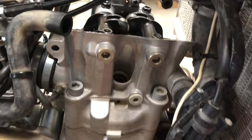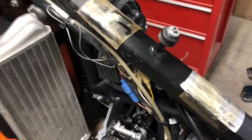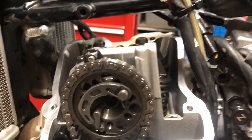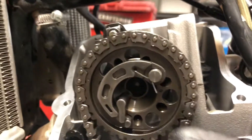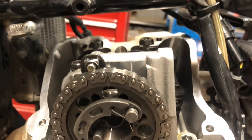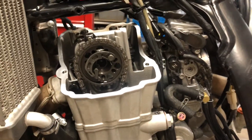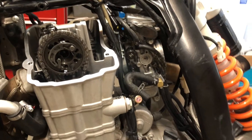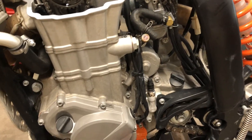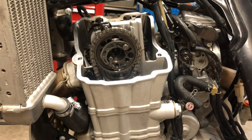Here's the motor with the valve cover taken off. I've also removed the spark plug, and that's going to do two things for us. First, it removes compression from the engine so that we can rotate it to find top dead center. It also provides a second way of verifying that you're at top dead center. What we need to do is align this little dot on the cam with this little impression drilled into the top of this rocker shaft bulkhead. Since the battery's off the bike and the starter can't be used, I'm going to use the wheel to rotate the cam — shift it into fifth or sixth gear for maximum leverage over the engine.